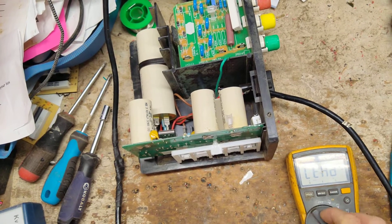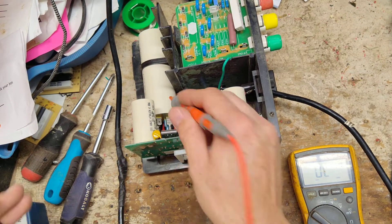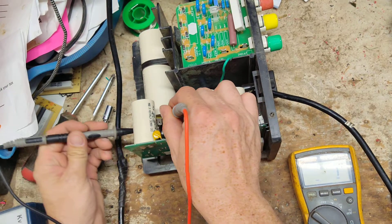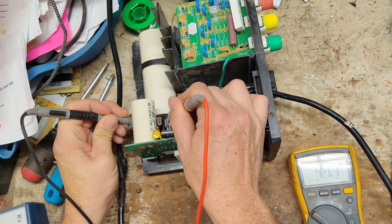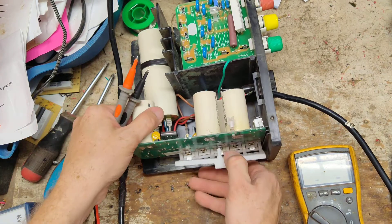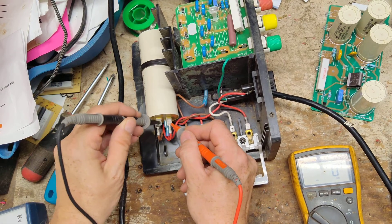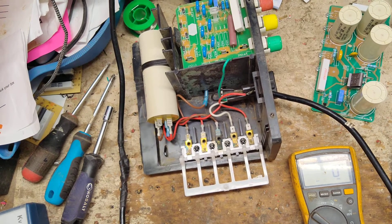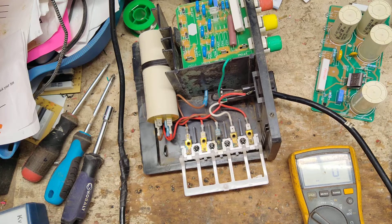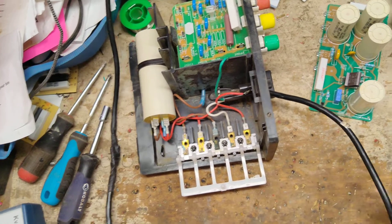We'll check the capacitor too, just to see how it's doing. That's a 40 microfarad capacitor, so we're going to go across those two points. It should read 40 and it's reading 41. Let's pull that board out first to make sure we're not getting any interference — it reads 38.1. That's pretty close to 40; two microfarads isn't going to make or break anything. You might get 0.2 joules less of energy. So I wouldn't worry too much about that.